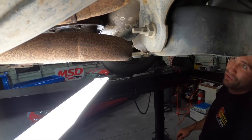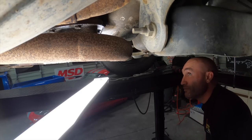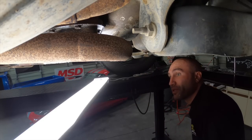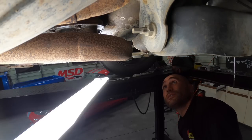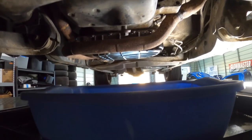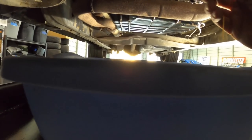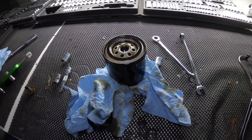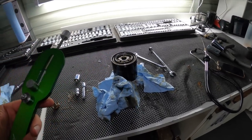I can't turn it over fast enough from the crank bolt to get it to click back and forth. But what I'm going to do is drop the oil and run that scope up there to see what we can see inside, since I've got that camera. So we got our catch pan — a clean catch pan so we can see what kind of material comes out — and let's drop the oil. I also took off the oil filter. I've got a filter cutter, so let's cut the filter open and see if there's a ton of material in here. It might just give us more clues.